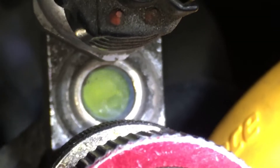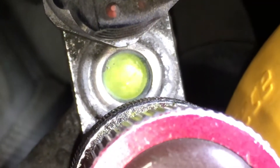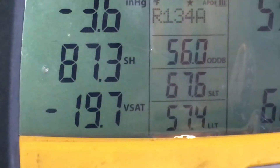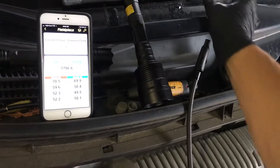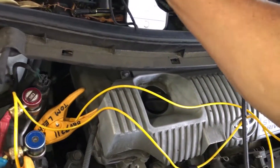There's a more powerful source of light — it almost looks like it wants to fill up. That almost looks like a sight glass that wants to fill right now. This must be super super low. We are still operating at negative three vacuum on the low side, so I'll move on to the next one — I've got to get moving because this vehicle has struts to be put on it.